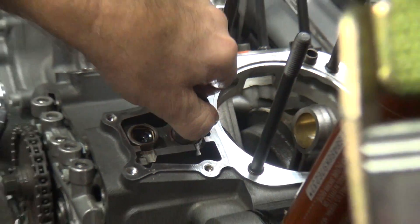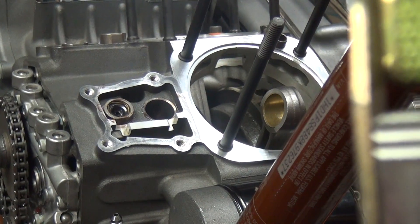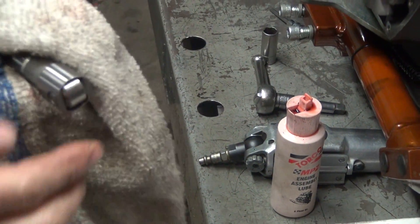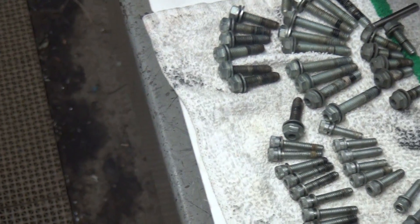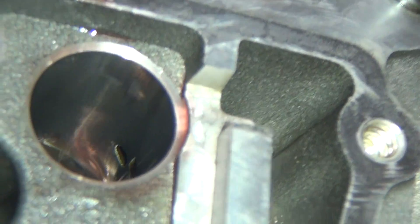This definitely does not want to go in there. We're gonna have to work on this one a little bit. Put the mic on it — it's just on the very tip there. Keep it going. First thing we do is we look for a burr here. Feel that right there with your finger. Do you feel that burr? I do. That could possibly be the problem. Is that from us, or do you think that was already there? It's hard to believe that aluminum jaw would be doing that. So we're gonna use our honing stone.